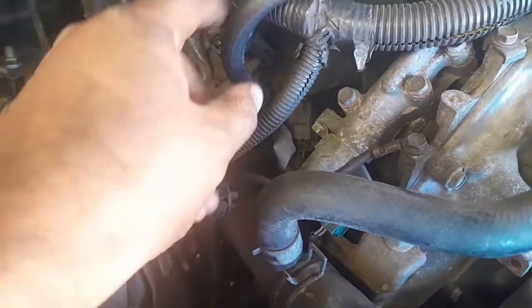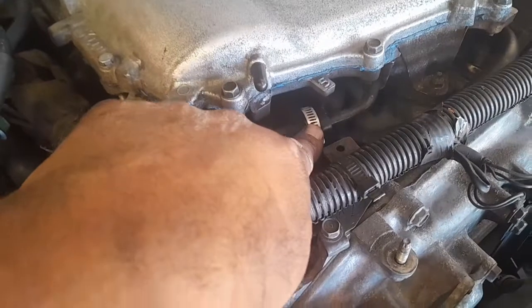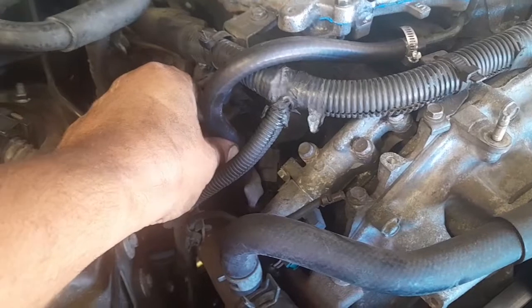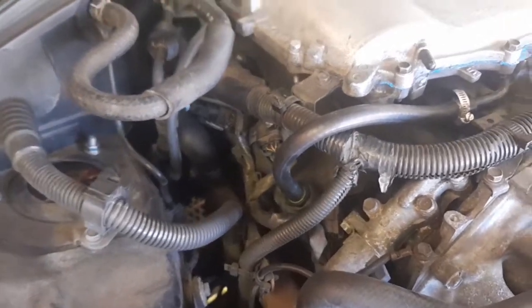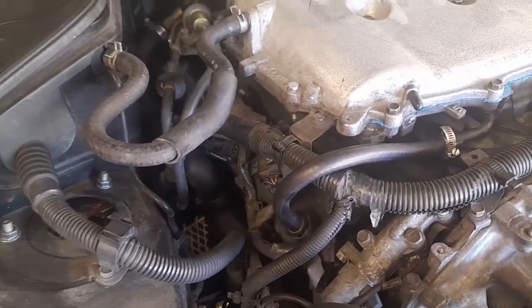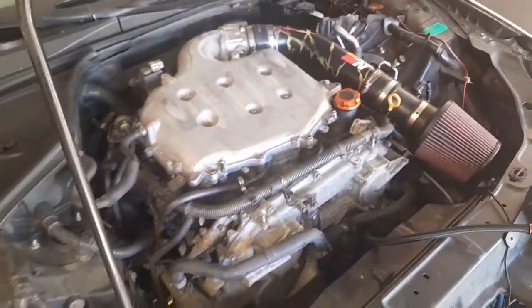So I leave it alone with no clip or tightening — just making sure the hose is good. I put the clip only on this side here. Before that, when you squeeze with the clip right here, you can feel the air leaking. If you have an air leak from the PCV valve, the computer can't manage how much air comes out of your engine, and it's going to give you an airflow problem.